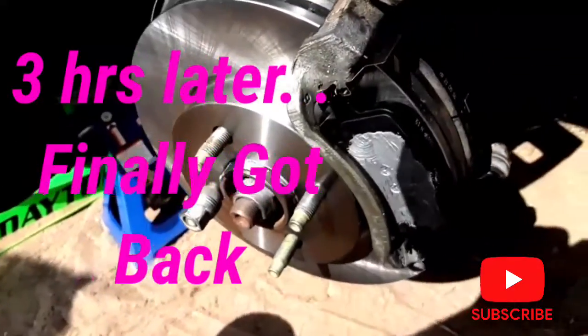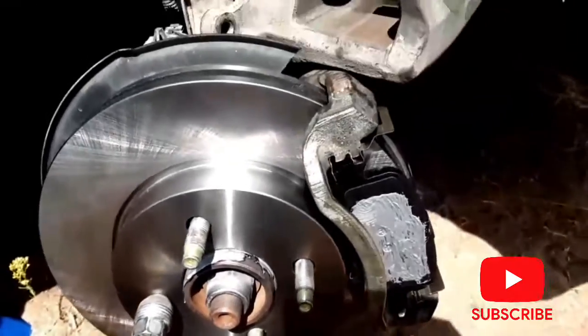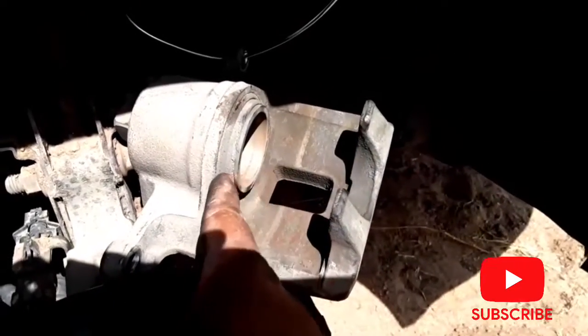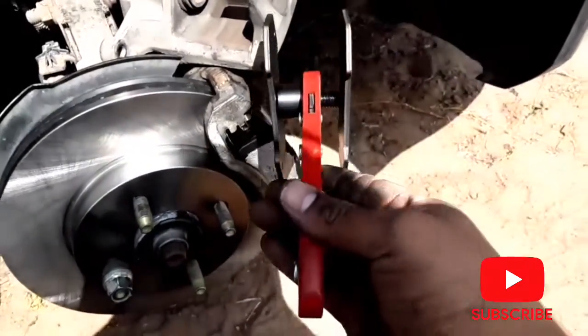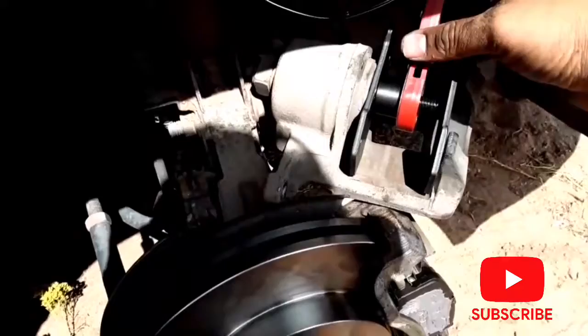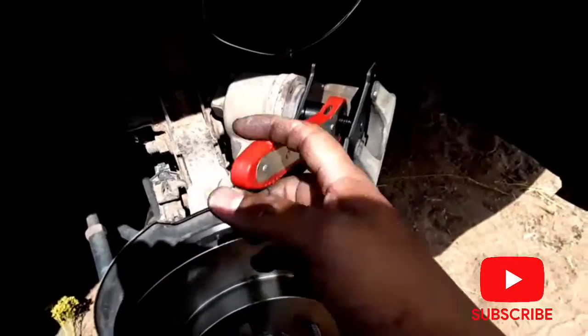We're almost there. I went ahead and put the brakes back on and put some anti-seize on there so it stays nice and lubed. There it is — brand new brakes, put back in. Now I'm going to be putting this cover back on here. This piston has to be compressed — pushed back in — so I'm going to be using this compression tool. A lot of people on YouTube use a C-clamp, which works too. I'm going to be pushing it like this.